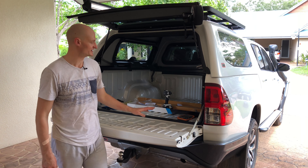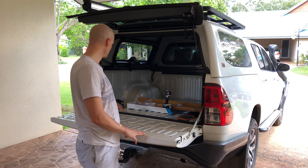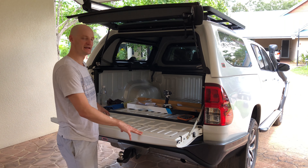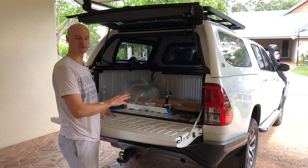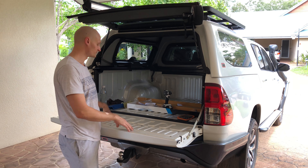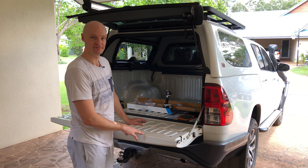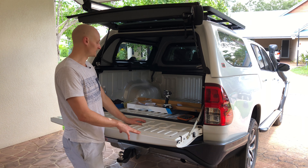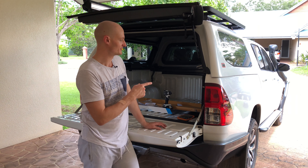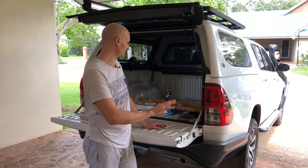I've pretty much finished the installation of the tailgate assist. The torsion bar was fairly straightforward to install. It was a little bit difficult once you had to get inside the rear of the tailgate because you've got to do it blind — a lot of sharp edges. I cut myself a number of times while fiddling around inside. I've got quite large hands, so it's probably easier if you've got someone with small hands nearby. I had a bit of an issue with the rear tail light — I couldn't pull it away from the body, but I just worked around it and was able to get it far enough to the side.